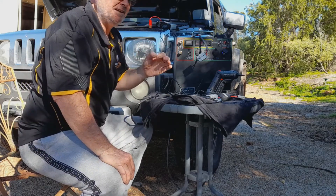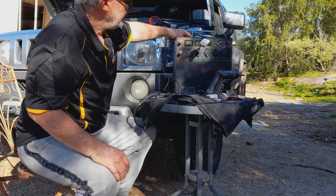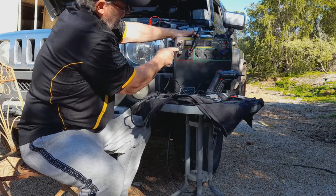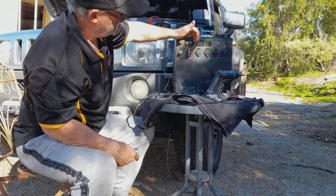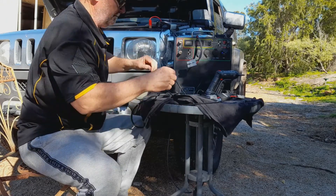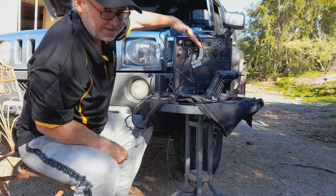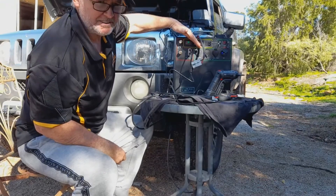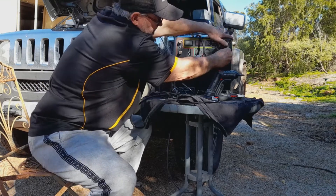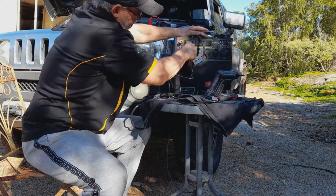So that's just showing you that if you do this and keep trying to charge it in the car directly, it's going to cut out. Doesn't matter — it's not going to take charge. Let's pull it out again, plug the AC-DC in. It's not charging until it's been reset. You can leave it for two days, it's still not going to work. It has to be reset. Take it out, put a one amp load on it, like so. Plug my charger in again — it's charging.